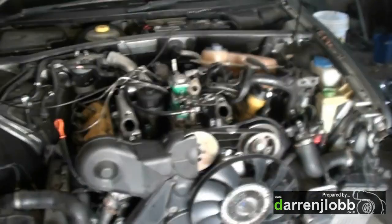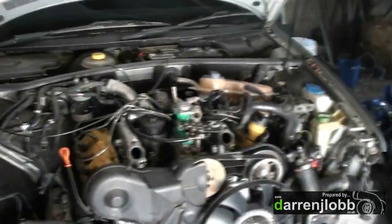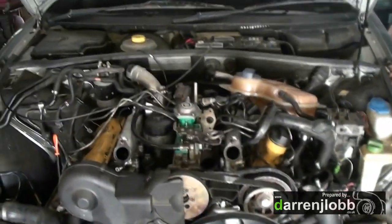I've got it back together and we're up and running. The new pump seems to be working a lot better, and the turbo's got oil and it's spooling up. Before I go putting too much more together, I think I'm going to drop some bigger injectors in it. I've got a set of nozzles here roughly the right size, so I'm going to whip the injectors out now.